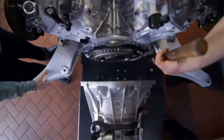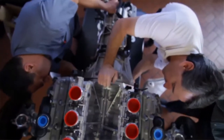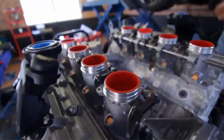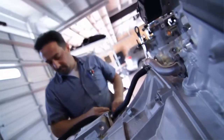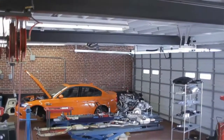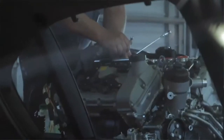We examined a lot of options as far as supercharging the car, turbocharging the car — traditional ways that people try to get more power out of a BMW or an M car specifically. Although they're great and on paper they look like they produce a lot of power, one of the advantages of going with the stroker motor is that it has a much wider and smoother power band. The torque and horsepower come on at a later RPM on a supercharger, whereas on the stroker motor you'll have horsepower and torque that come in at a lower RPM and sustain through the RPM range. When you're in the middle of a corner, say at the apex, you don't want the power to come on suddenly — you want it to be predictable and gradual. That's the advantage of the stroker motor: you wind up with a very wide torque plateau and a nice smooth power curve.